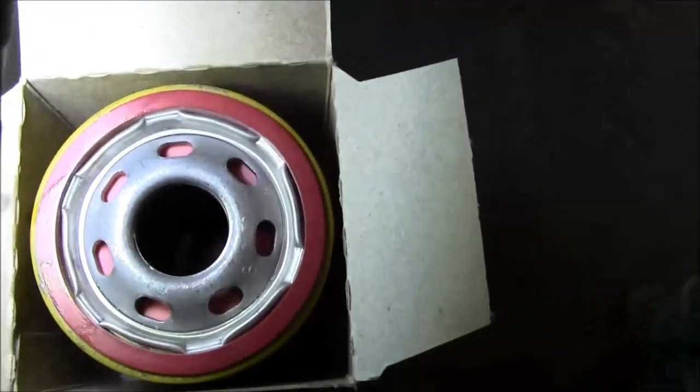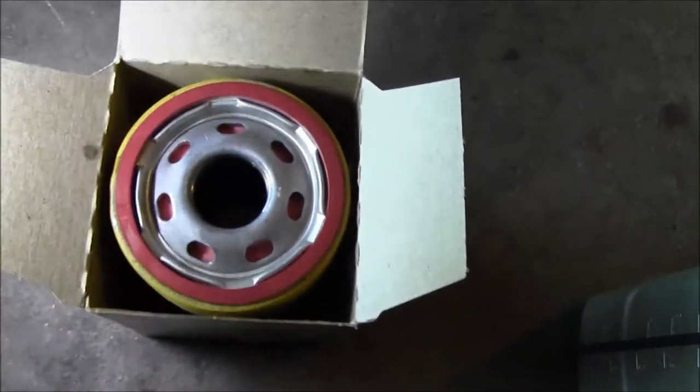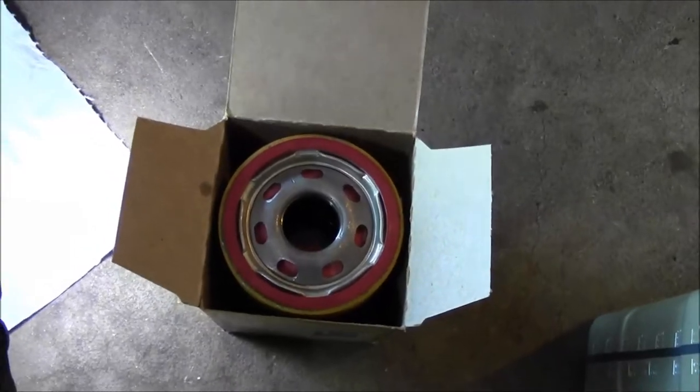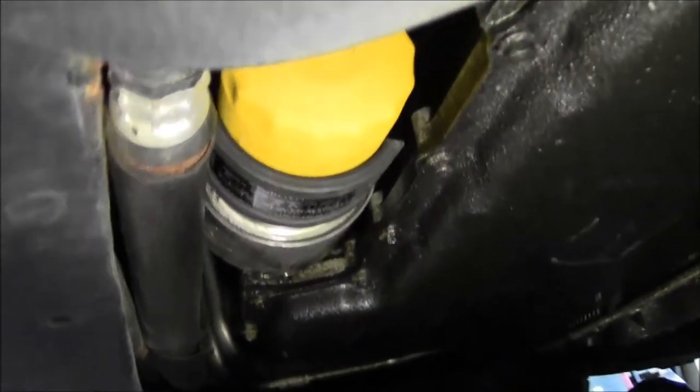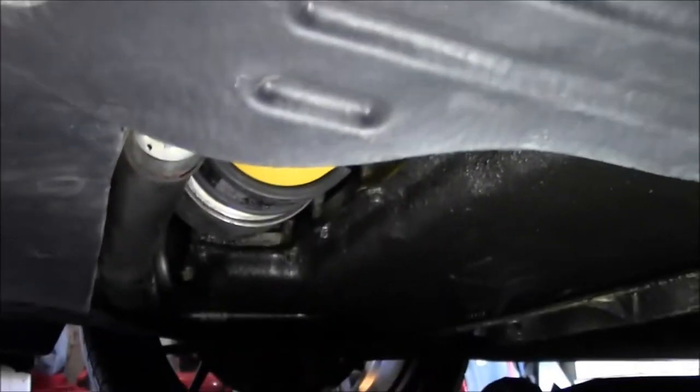All right, so the oil level's settled down. Just want to get a little bit of fresh oil on that gasket. And this filter is ready to go back on. Just have to clean up where it mounts onto the engine. Got the filter back on there, got the filter mag on there. I'm ready to put the drain plug in and start filling it with oil.